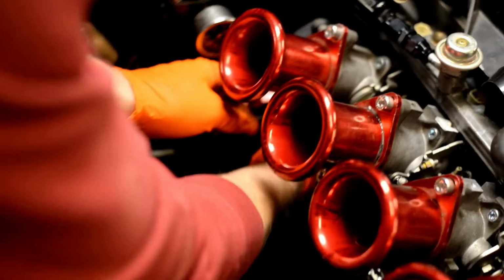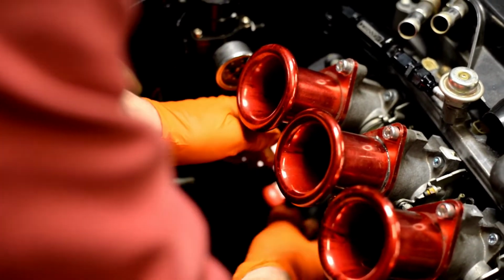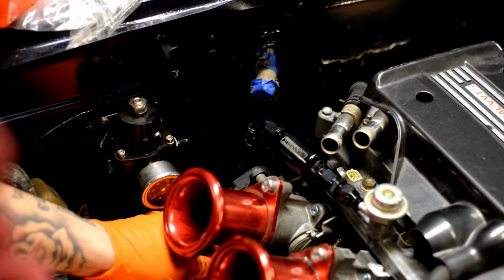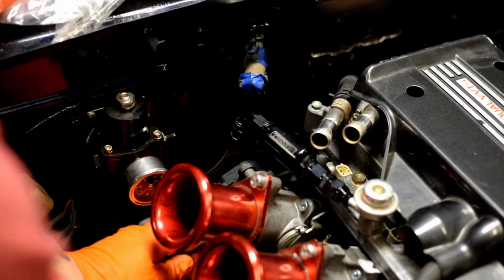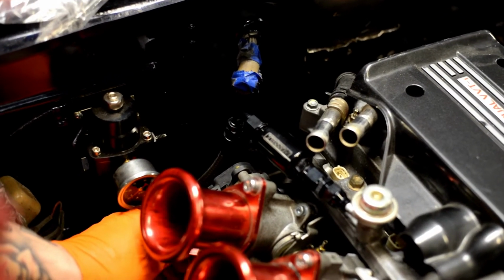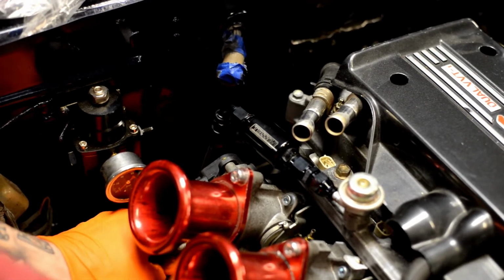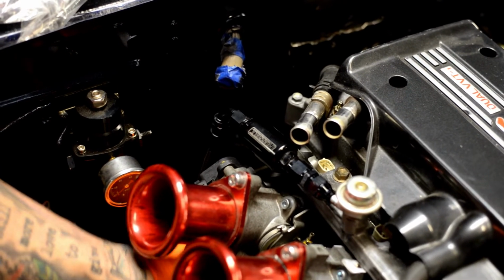Casey right now is cutting the fuel send line shorter because it was too close to run the AN fittings and attach to it in its current location. So we're gonna tackle that, and then we're gonna run a line off the fuel rail to go to the return. Hopefully we have the right fittings to do it.